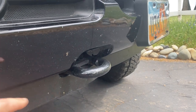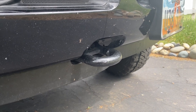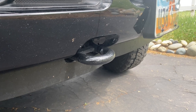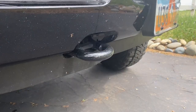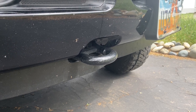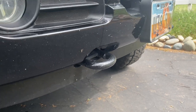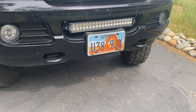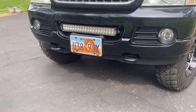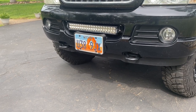These Explorers typically didn't come with tow hooks, but they have the mounting capability for them. If you go to a junkyard and find a pair of tow hooks from a similar generation Ford F-150 or Excursion, they just mount right up. I went ahead and added those to the Explorer. It gives it a nice aggressive off-road look up front and also gives me solid anchors if I'm off-road getting pulled out.